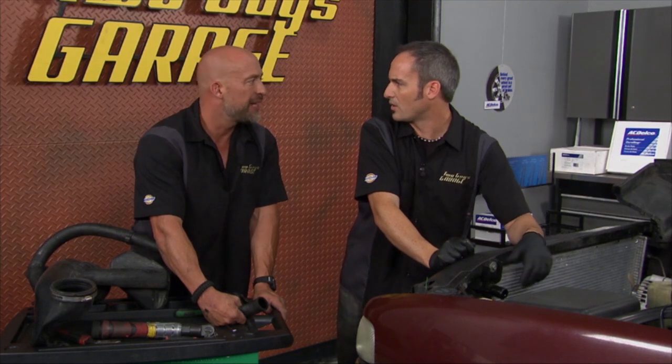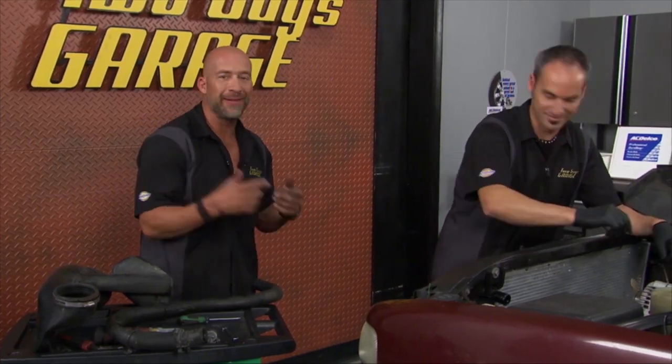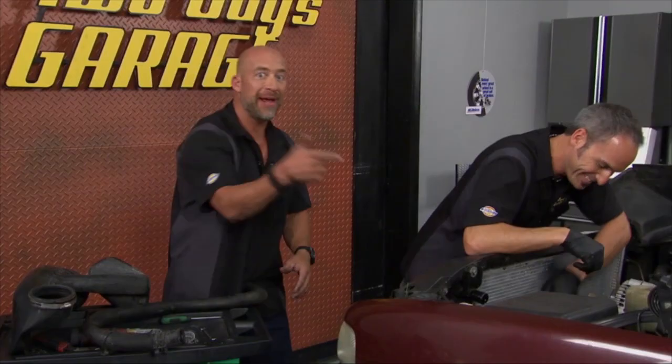So all of that, by the way, encourages all that corrosiveness that you're going to see chew up radiators, chew up heater cores. So you think, oh, I look at my coolant, it looks orangish. It's all right. I'll throw some tap water in there. Maybe some pond water, you know? But there's chemistry happening in there, and that's why doing a proper drain and fill or getting a certified proper flush keeps all this stuff alive for many, many miles. It's just stuff you would never guess, but that's why we're here and that's why we're doing it. All right? Now, back to it.